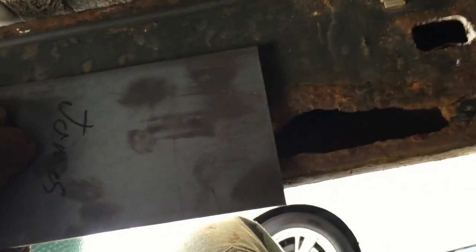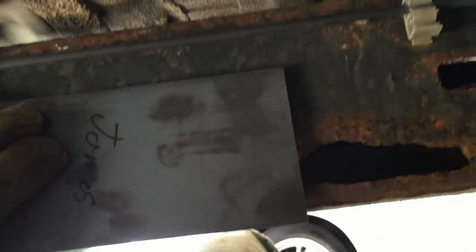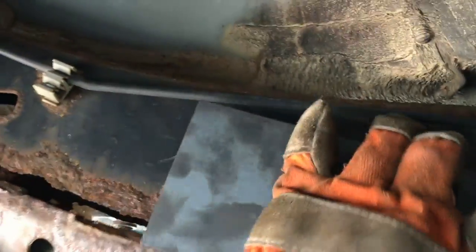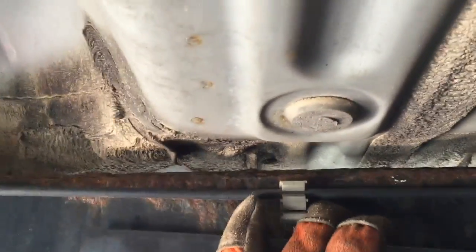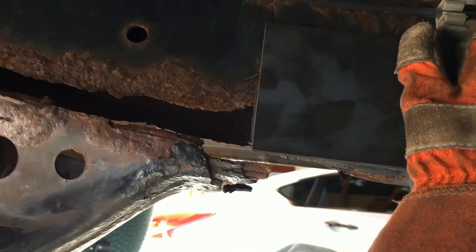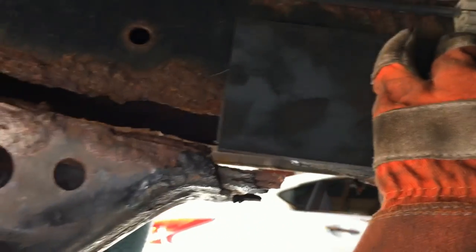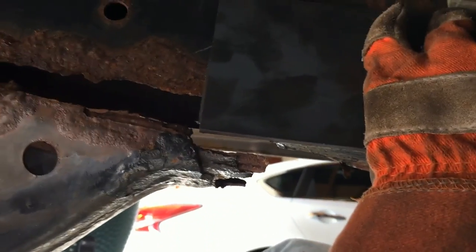I'm under the car. Here's a 4-inch wide piece of steel for reference. With the 4-by-3 structural steel angle, the 4 inches will go up against the frame. What I'm trying to achieve is to reach a place where I have some strong frame metal to weld against. I want the structural steel angle iron to come up to about here — overlapping the bottom of the piece that's hanging.